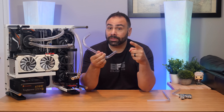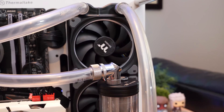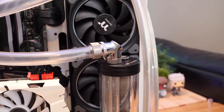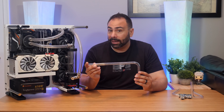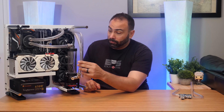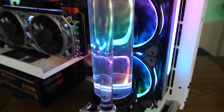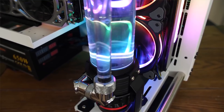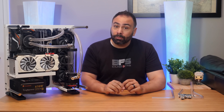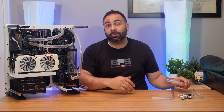Can you make a bend go from here to here, or is that beyond your skill or comfort level? Can you implement a fitting instead? I take huge advantage of 45 and 90 degree fittings when building hard tube systems, especially when exiting CPU blocks and pumps. Often you want to establish a long, straight run if you can, unless you're specifically going for something funky. This right here is a perfect example — I used two 90 degree adapters to position a direct vertical run from the pump up to the radiator, making the simple task of one 90 degree bend instead of something convoluted. You also want to try to avoid bends that aren't 90 degrees when first starting out, as making one clean, precise 90 degree bend is difficult enough without having to worry about a 57.3 degree bend as well.